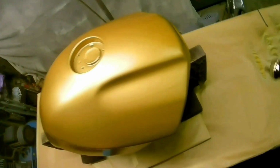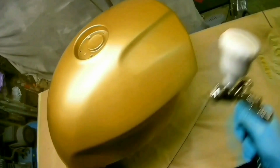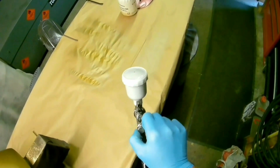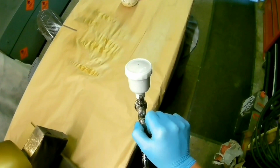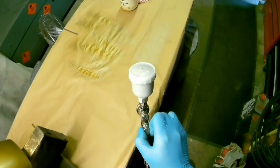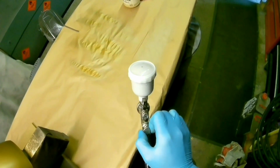Now, I haven't got enough of a compressor. I've got 2 compressors linked, and they're 140 litres for the pair. If you turn both of them on, I've got 20 odd CFM, but I normally only have 1 running, which is about 14.5 CFM. So it's certainly not enough to have loads of air coming out over the tank. And of course, the other thing in my environment, and other people at home would have to be careful of the same, is blowing loads of dust around.